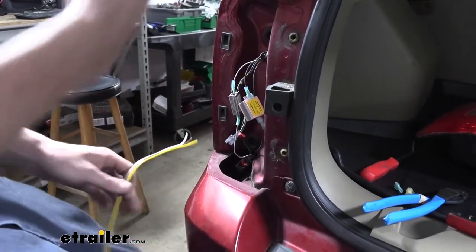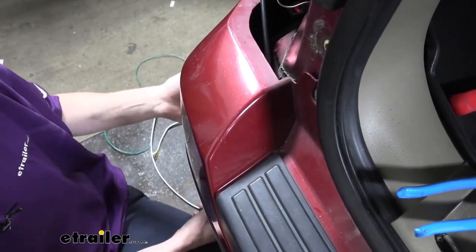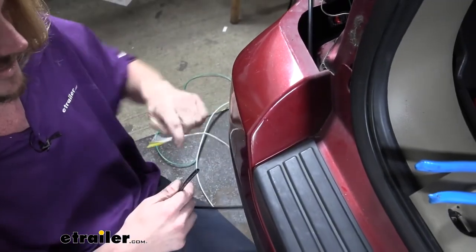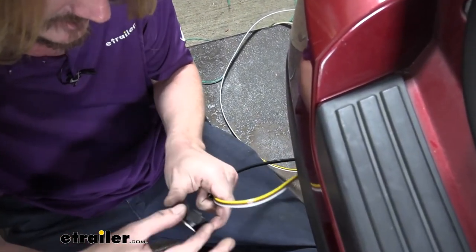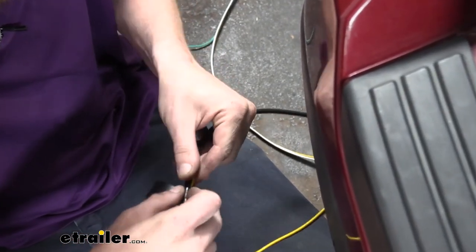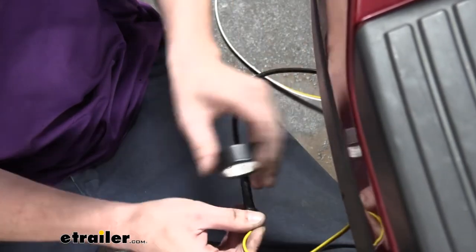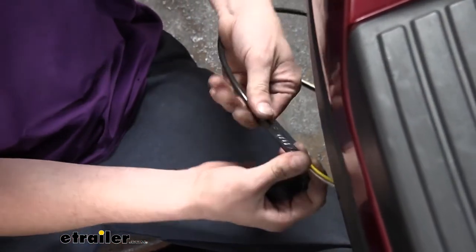I'm going to grab my fish wire now and feed this down — we'll tape our wire to it to bring it up. Here you can see we're kind of flossing our bumper. We just took a piece of airline tube; if you're doing this at home, a metal coat hanger also works pretty well — you can unfold it, poke it down there, and then just reach up in the bottom to find the other side. What's coming out the bottom, we're going to take the wiring with the white, brown, and yellow, and tape it with some electrical tape. I like electrical tape because it kind of stretches, so it gives you a really tight grip that works well when you're pulling wires through a tight area. Tape it all the way down — make sure you tape it even at the bottom because you could have a stray wire that folds over and prevents this from pulling back up easily.